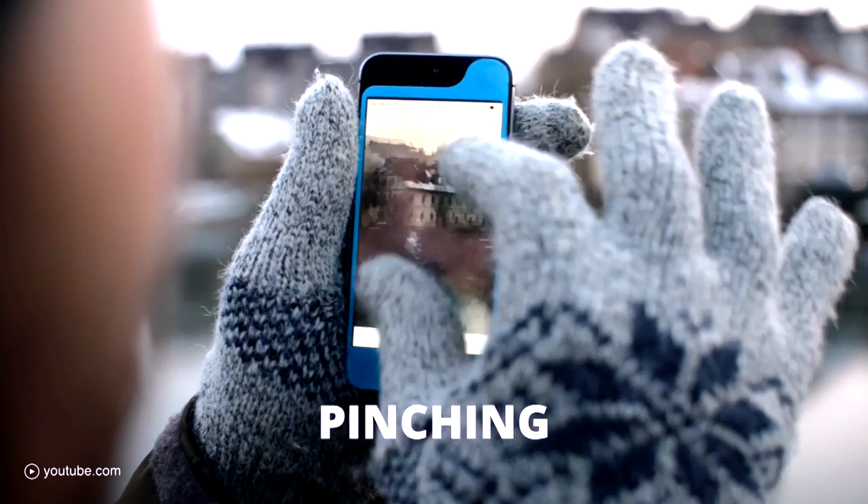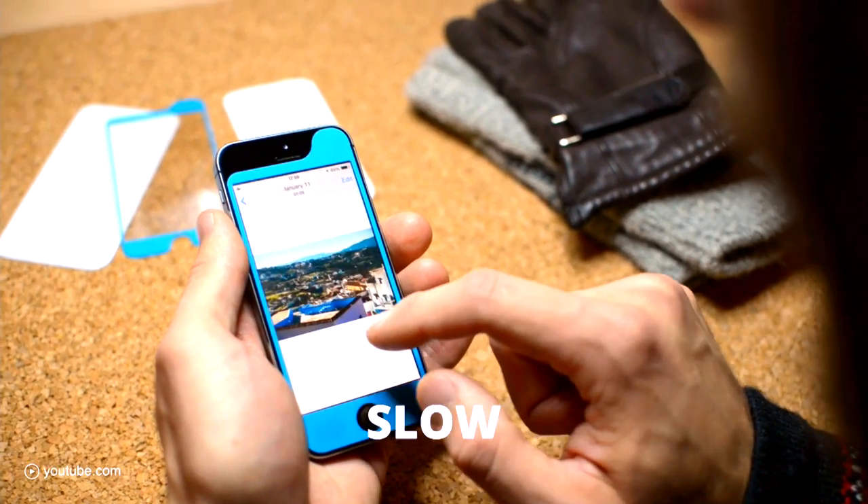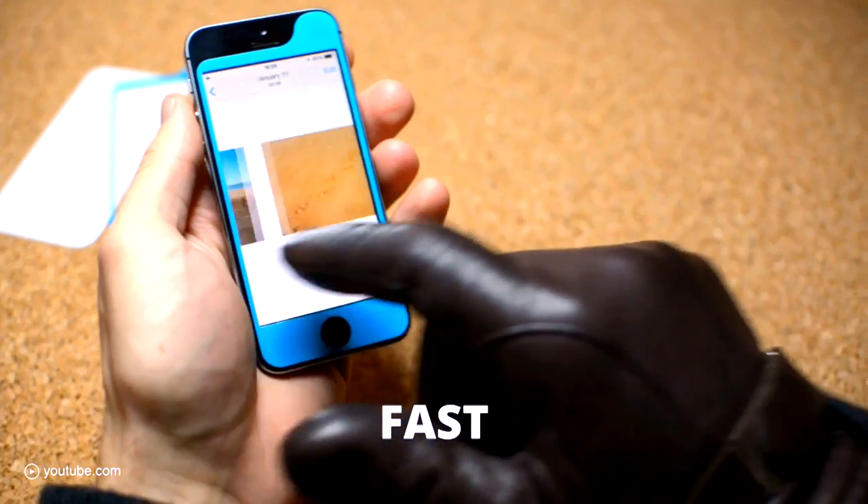That's why we came up with another film that you put on the new screen, and suddenly you have the same basic principle. You just have to push it together and you change the electrical charge on the touch screen, and it senses your finger or glove. Basically, the theory is you can put anything on the screen and it will sense it, but because the software is designed to sense shapes similar to a finger, you have to use your finger or glove to get the best results.